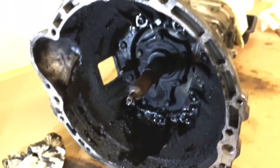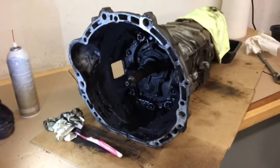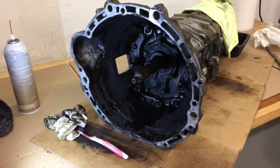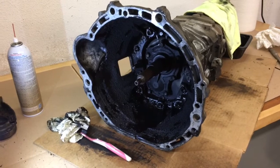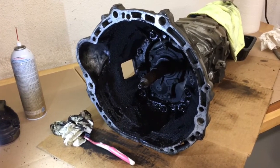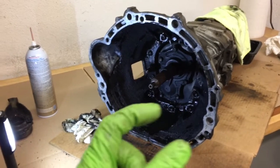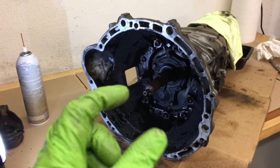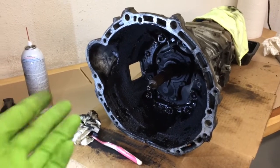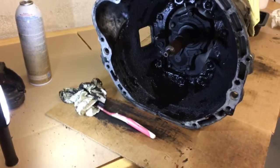I stripped the head on mine, but I was able to use a 14 or 17mm, whatever the size was, Irwin Bolt-Grip style socket. If you're not familiar with it, check out their sockets, because they are really good for extracting rounded bolts, because they grab on the sides of the bolt. So when you get into a situation where you've stripped out the head of a bolt and it's the only thing standing between you and getting your transmission off, it will save the day.